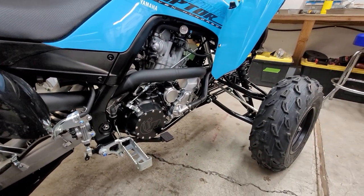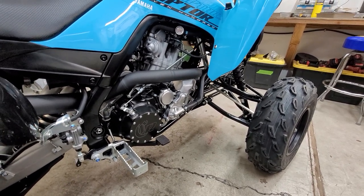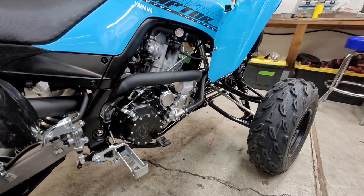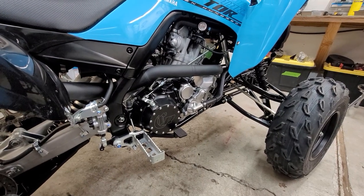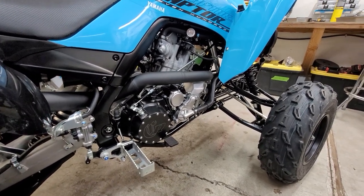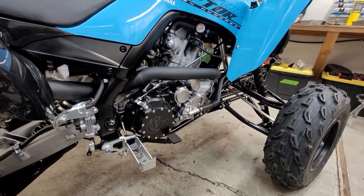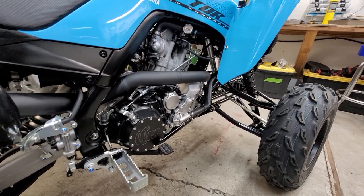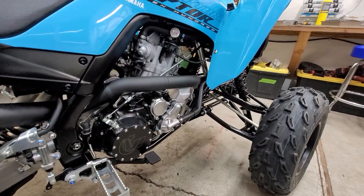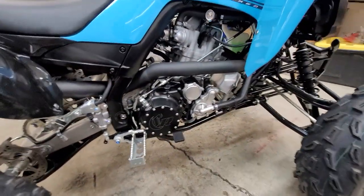You don't want to be out pushing a bike hard and it be up at the 225 range and that fan's just hanging out waiting for you to overheat the thing. So next is we did a drain plug reducer underneath. That helps with not stripping out the case over time, reduces, put a smaller bolt in there. AIS plate on the head there to get rid of the popping.